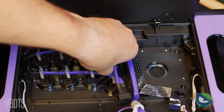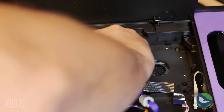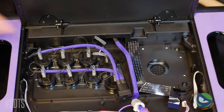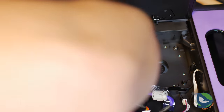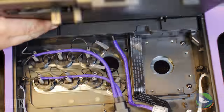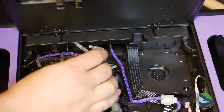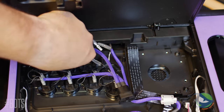The quick disconnects on the buttons are identical to those used on the TE2 Fight Stick by Mad Catz. They have release mechanisms you can push with a small screwdriver to easily remove them — I was able to use my fingernail fine. The included buttons are Sanwa OBSF snap-ins. I was curious whether screw-in buttons would fit because the plastic moldings inside looked kind of cramped.